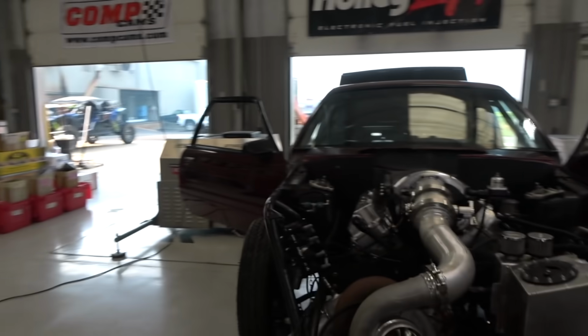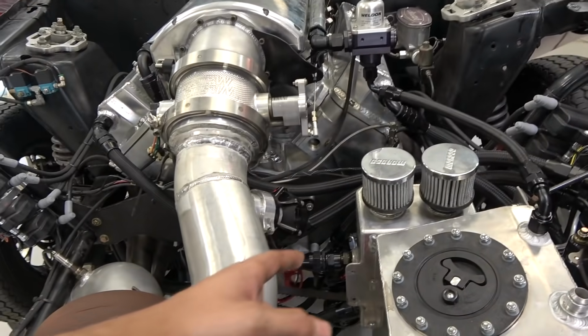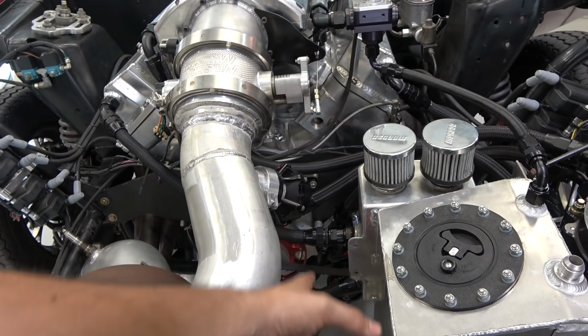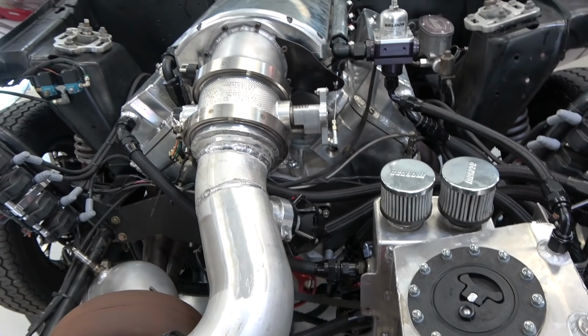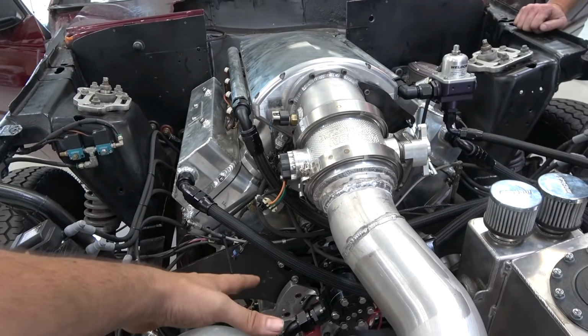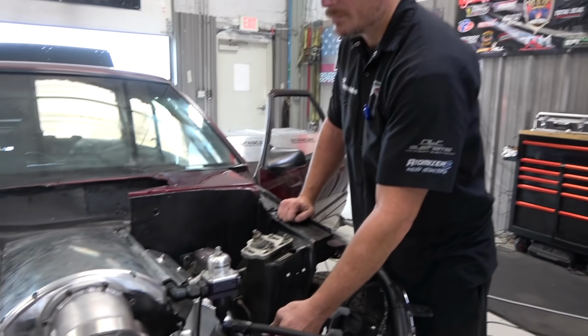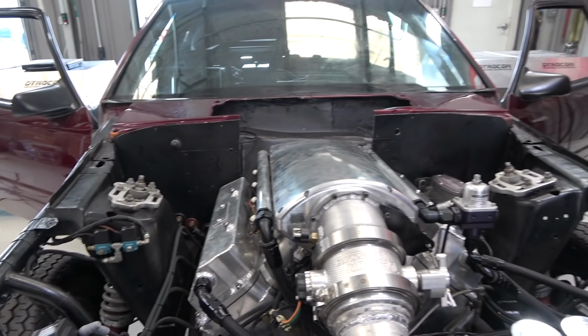Well, all right. I think we have knocked out a couple little issues that we've seen. Had to adjust the pulley, which we knew we kind of had to do. And then, like we talked about, we got the balancer issue, but that we set time at the shop, so we kind of checked that one off. Everything else, I think, is good.